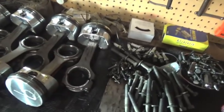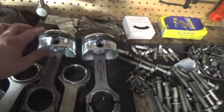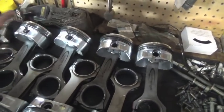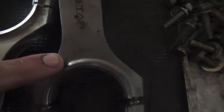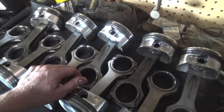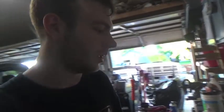We got all the rods and pistons out. It didn't smush any of the tops of the pistons and it didn't pinch any of the rings, so that's a good sign. Now you guys know that answer already — these are too long of rods for this motor. That was my noise the whole time: the pistons slapping the heads because they are 31 thousandths too long.